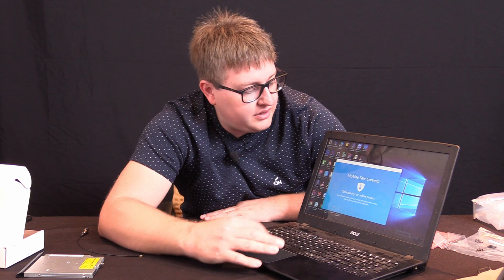I believe I've plugged it into the input channel. Just so you know, this is actually one of our staff members' laptops that we've put a temporary drive in with Windows 10 installed, just to make sure it works in all areas. What I've noticed with this card so far is that it doesn't work with Livestream Studio — I don't know if it's got to do with the SDK or driver support. I've noticed Livestream Studio picks up most webcams, and I thought this would come through as a webcam. I've set this up with OBS Studio instead. One last thing I noticed is that if it's not getting a signal, unlike most other capture cards I've dealt with — mainly the Blackmagic stuff — it doesn't tell you that it's not getting a signal, so you don't know if you're getting a picture from the card.